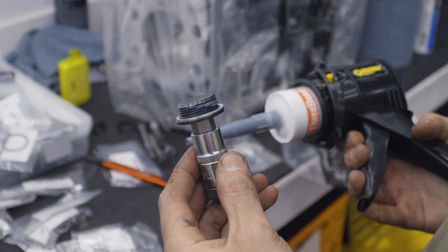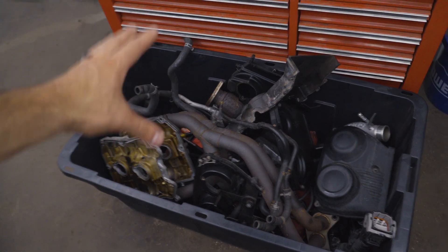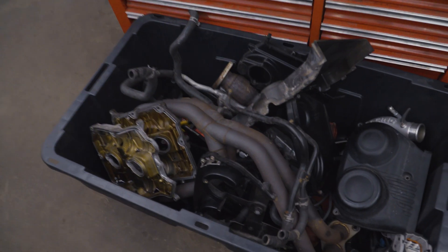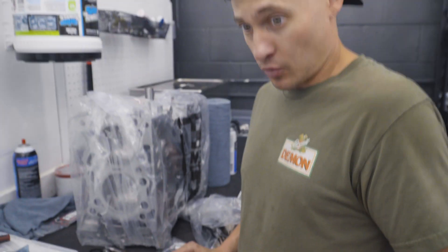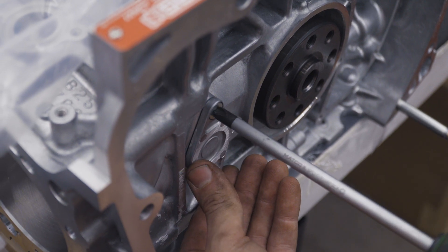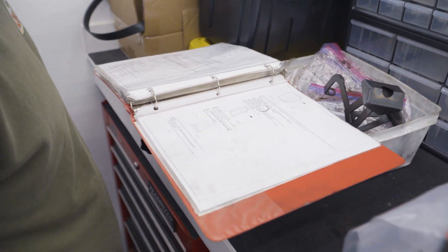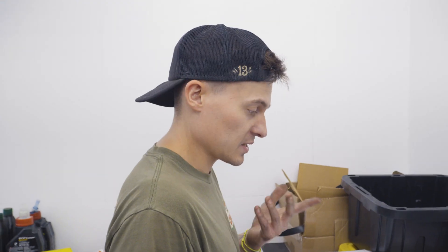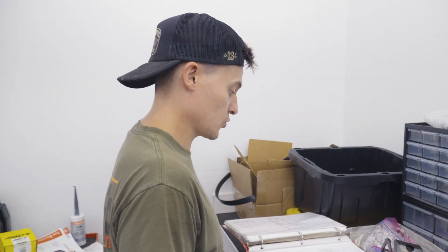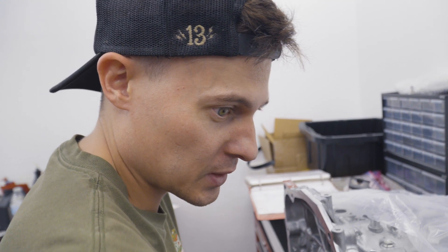Cranking into the install, the whole contents of the box are going onto this engine by the end of the episode. They install a service hole cover with an O-ring and a little blue lock on it. The booklet has all the torque specs — 4.7 foot-pounds. There's one special screw with thread locker indicated by a small arrow.